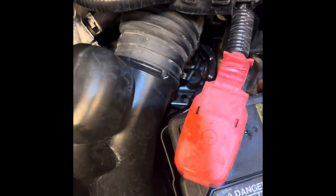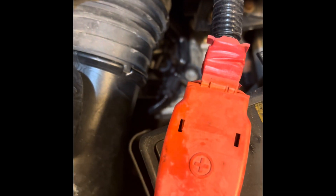Looking down at the engine, we will see the transmission plug down there, right there with the silver handle on it. Here's the transmission plug right here. A lot of times what you'll find is that the transmission plug will be sitting somewhere on top of your engine and that hole is going to be open to water and other debris. So you want to double check and make sure that transmission plug is in there.